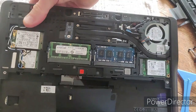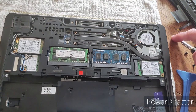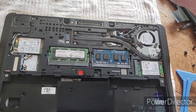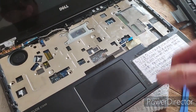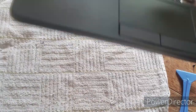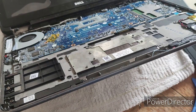The problem here is that on the base there are two screws either side of the docking station which need to come out. Remove those, then turn the laptop back open — and there we go, the palm rest finally comes off.